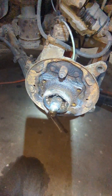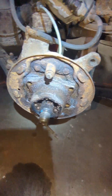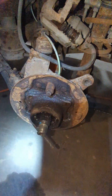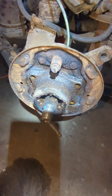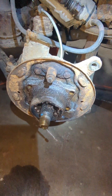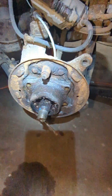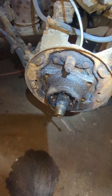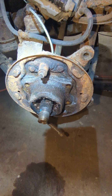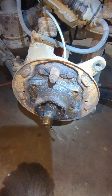Jackhammering didn't work, so I took a break and went on the internet to see other people's ideas. Nine out of ten ideas were to use the bolt trick, which would just rip this thing in half. Then I saw Eric from South Main Auto — he had a video where he welded a nut to the Subaru rear wheel bearing, and that's the only way he said he could get them out. I guess these are notorious. The later model Subaru ones give people a hell of a time, and there's a special tool you can buy for $900.